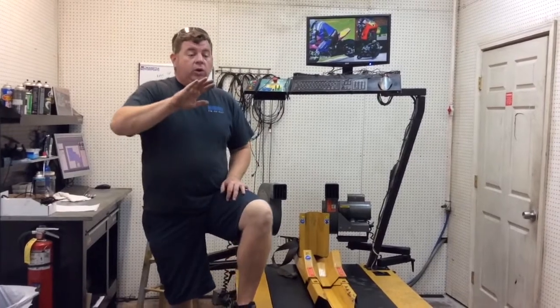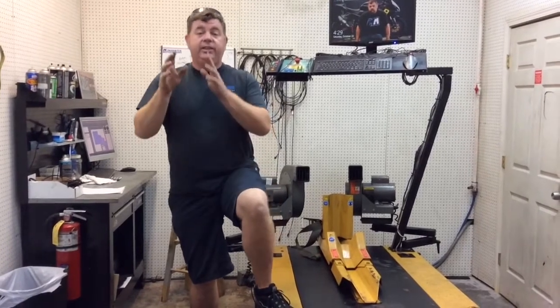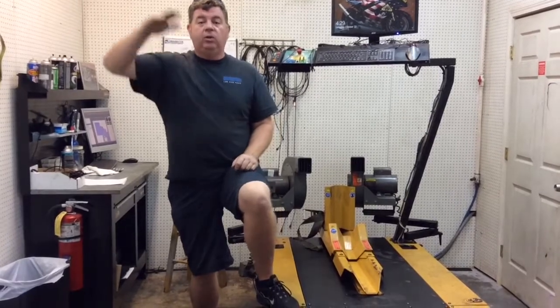So we'll tune everything to 13.2 to 1, and then I'll go back and look for power, make sure rideability is still good, turn on some advanced features in the Power Commander or the Bazzaz that you may need. For example, the accelerator pump feature, so that whenever you give a big change of throttle position, it actually richens or leans the bike up for a given RPM so that it can climb up out of that hole and start getting back into the regular parts of the map.